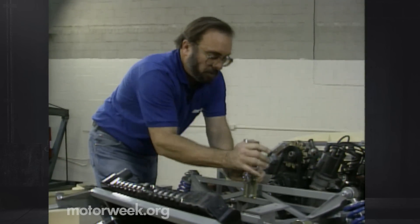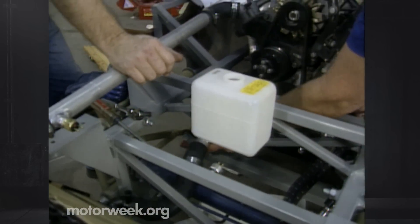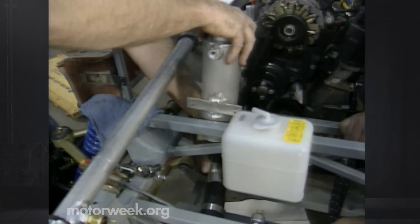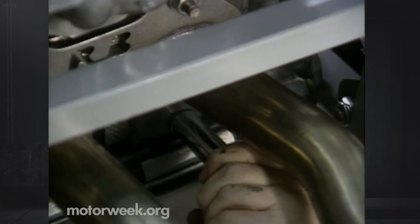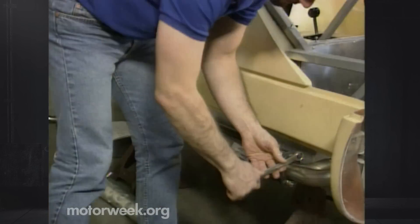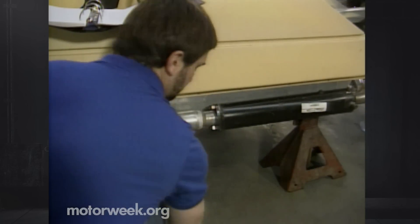After the engine's in, all sorts of things can be bolted on. The cooling system has to be put together. We're impressed with the way the components are fabricated, but we found the instruction manual made about as much sense as a metric adjustable wrench. We had the first draft of the manual and we're assured the later version is much more complete. The exhaust header can also go on at this point — the flange comes from a company called Racing Beat, which makes Mazda performance parts, and the header comes from Maxton. If you choose a late model rotary for your Maxton, local laws may require you to meet emission standards for the year in which the engine was manufactured, meaning you may have to use stock exhaust emission equipment. We're told there's enough room under the hood to fit a catalytic converter.